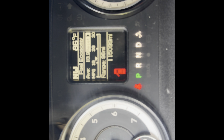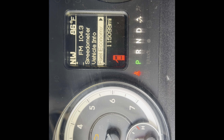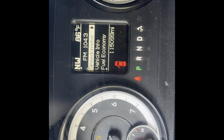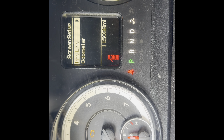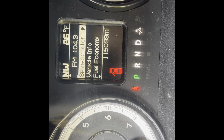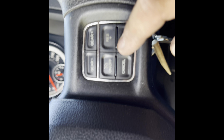For now, just to show you what it does — once everything boots up, you can see it's sitting in my fuel economy display. To access it on this dash, you need that FM reading in your center display. If you can't get to that, scroll down to screen setup, then info line, and make sure that's set to audio. Once you get to that point, it'll come over here — you hold and push the cancel button, and you'll see it change into economy mode.